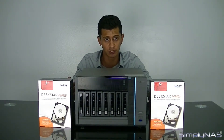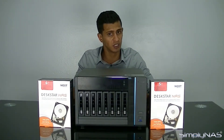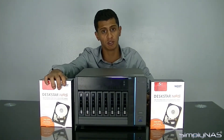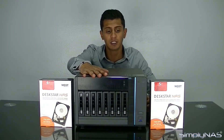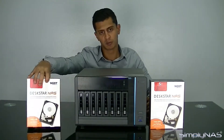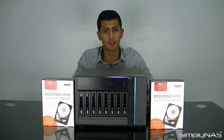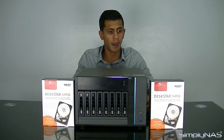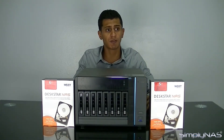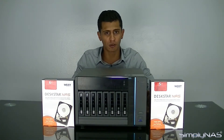Depending on the RAID you use, you'll either protect yourself or you won't. At minimum, you should always do RAID 5 — that way you protect yourself from one drive crash. If you go as high as RAID 10, half your bays are redundant, so if one hard drive crashes you're not even in a degraded state. Hot spares are a good idea unless you've got a spare hard drive sitting next to your NAS. With RAID 10 in particular, we typically avoid recommending a hot spare because you're wasting space — buy a cold spare hard drive instead and have it on the side. If you've got 4TB drives, your only restriction is the 4TB size. We recommend sticking with the same brand and speed, but if that model isn't available five or six years down the line, as long as you stick to 4TB you'll be absolutely fine.